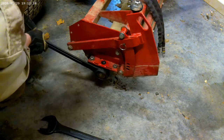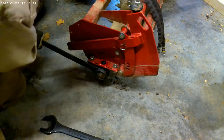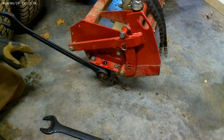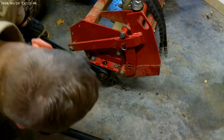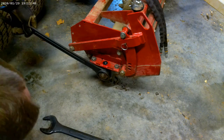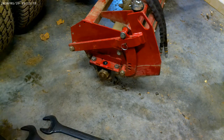I'm not even sure how tight this thing actually is, so that's where the impact driver really comes in handy. You know, you get one of these deals that's just stuck on here. I don't think there's any way I'm going to be able to jar this enough to be able to get it loose. So now we know that we're at a 1-7/8 — it's probably just under that size, but pretty close. I don't think we'll be able to actually physically turn this thing and have enough torque to break it loose without the drum being forced to rotate as well.